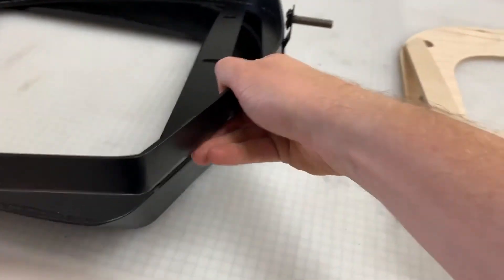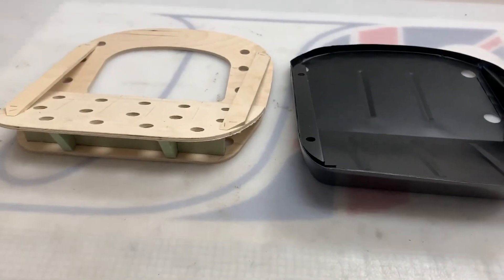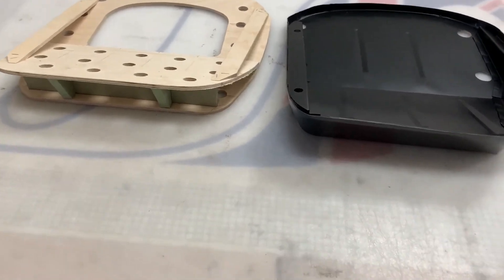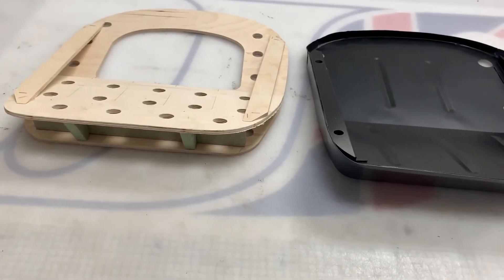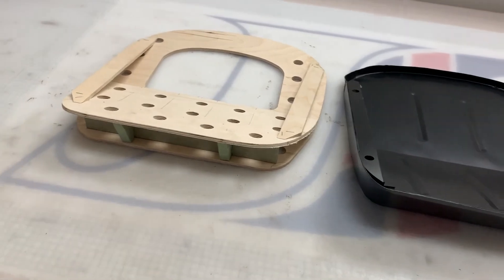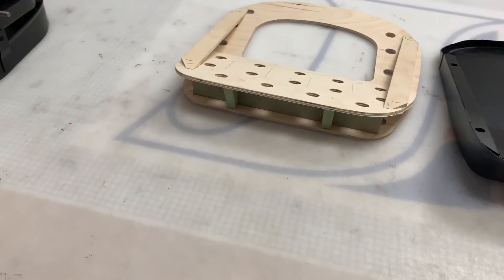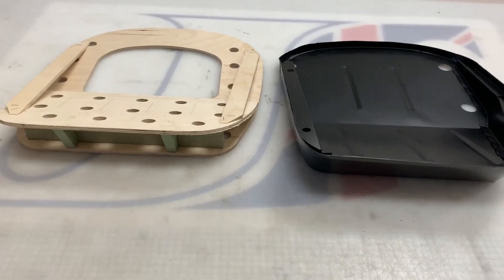As mentioned in previous videos, if you're buying a lot of the seat hardware, we recommend dummy fitting all the hardware together before putting the foams on and before putting the seat covers on, to ensure everything fits and works correctly prior to trimming. As soon as you trim something up it's a bit of a one-way street — the cover holds it together and restricts how much you can manipulate the framework to get the best fit. We always recommend doing that first to avoid any potential problems further down the line. So those are the cushion bases.